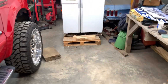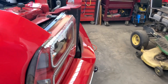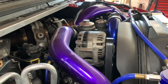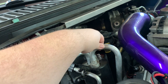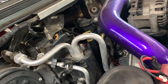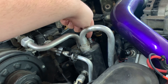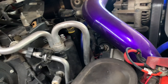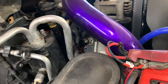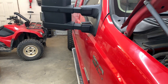So what we're going to say is it's probably stopped up. When I got the truck, the AC never really worked. We replaced the AC compressor, which is way down there under the world. We replaced the evaporator, the switches — replaced lots of stuff and it never really would work. We did replace this because this fitting here had leaked and was actually stripped out. Looked like someone cross-threaded it. When we replaced the orifice tube, it was full of what looked like slime — we figured that's probably stop leak.